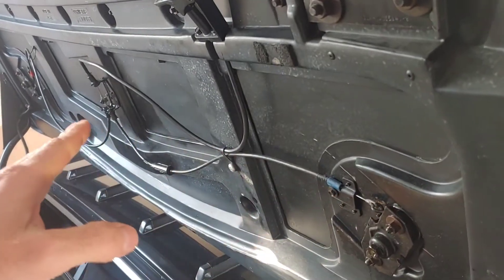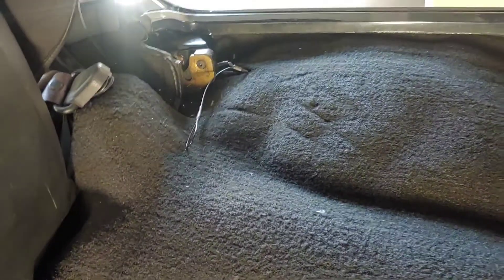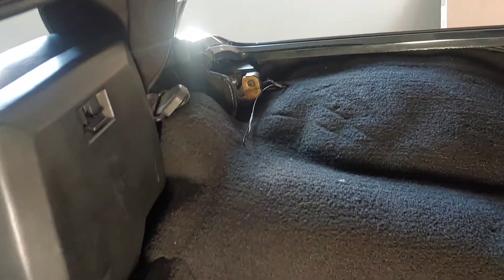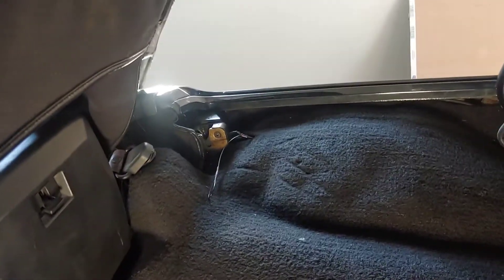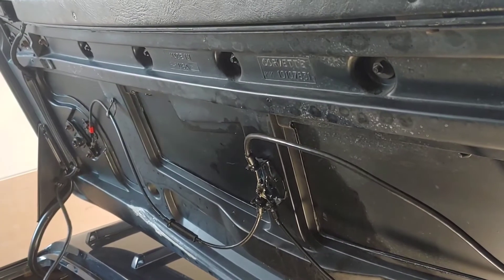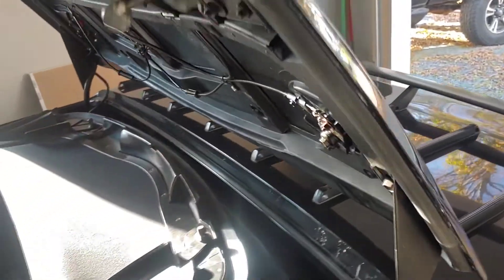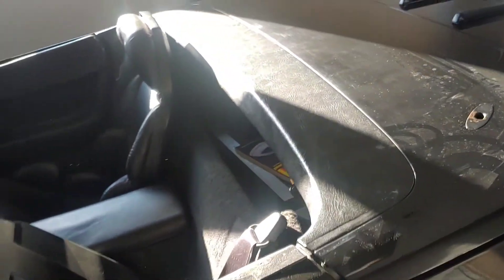My car didn't have any of this when I bought it. There are little toggle cables on either side, and you could use those as a cheat to release the mechanism. So once I discovered those, I was able to release my roof, but before that I had no idea. Back then there was not much information online. Once this roof is free, if we've released our front latches, we should be able to lift this roof up and simply fold it into the back. My roof is folded into the back — take this lid and shut it. And there we go. The top is down.